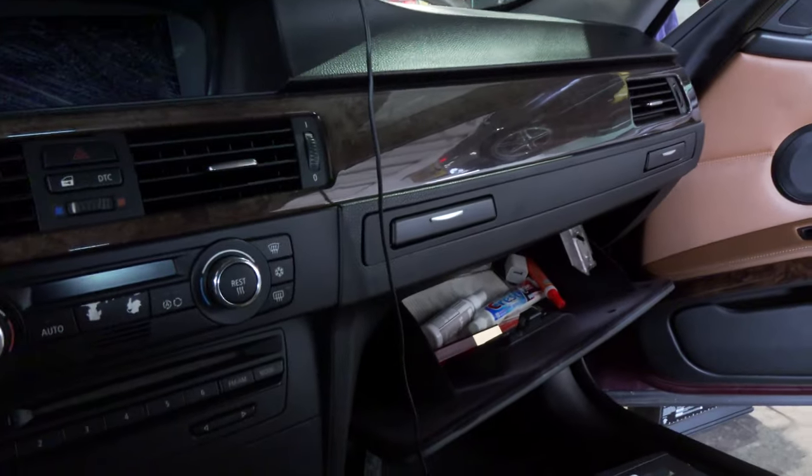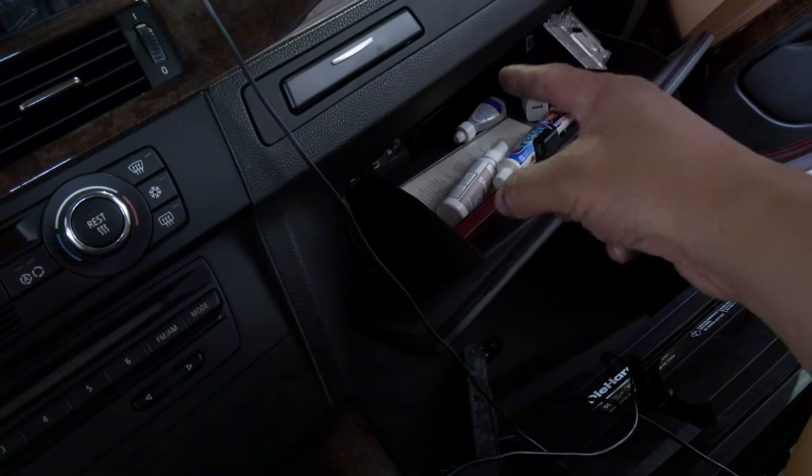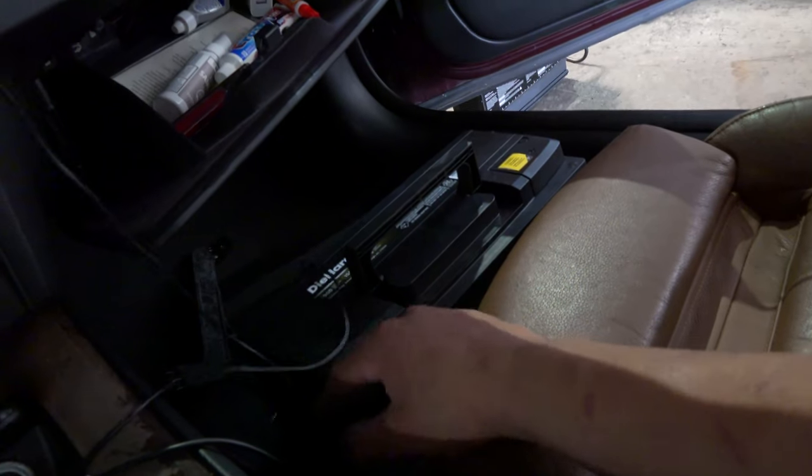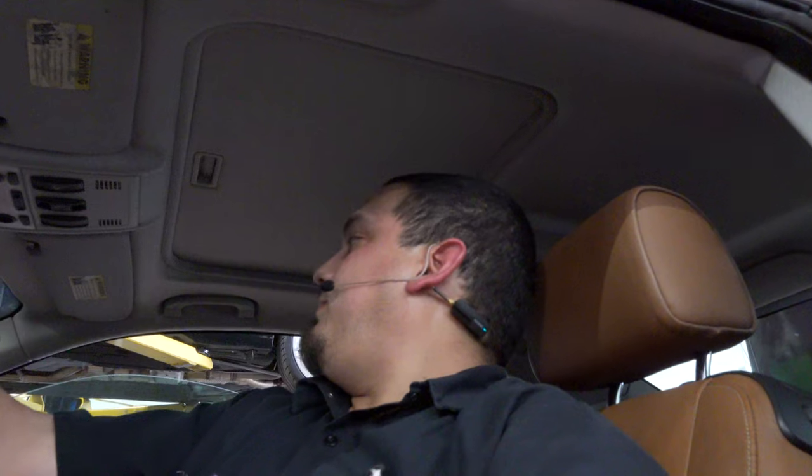Do a complete scan of the entire vehicle with a thermal imager. I also went ahead and prepped the glove box open because, for those of you who are familiar, the junction box electronics module — basically the smart fuse box — is housed behind the glove box. They already have a second battery so that once we fix the parasitic draw we could go ahead and install it. It came from another shop for other reasons which we already fixed, and now we're dealing with the parasitic draw. This vehicle has been sitting here since yesterday after we fixed the first phase, which was a crank no start. You do not want to do a thermal image scan when the vehicle has been warm — everything should be pretty cold.